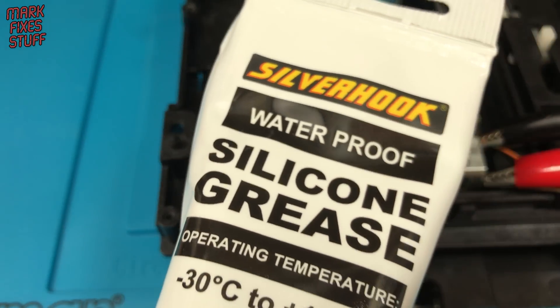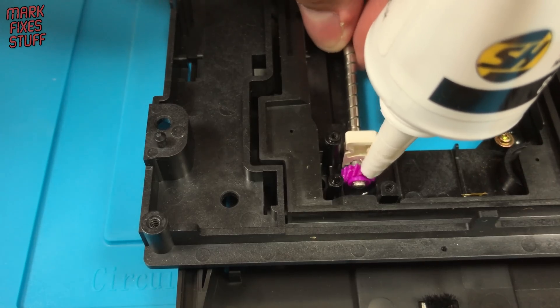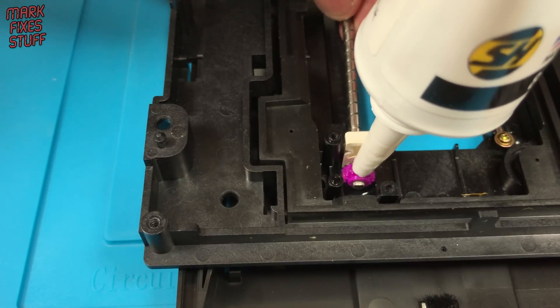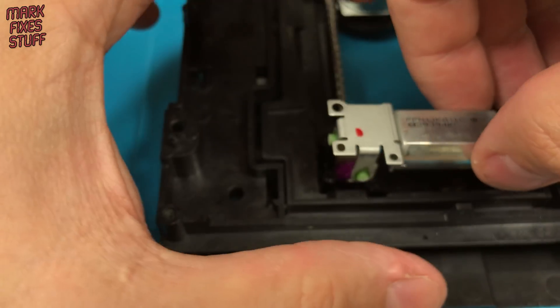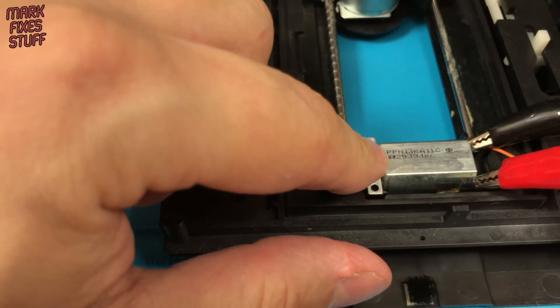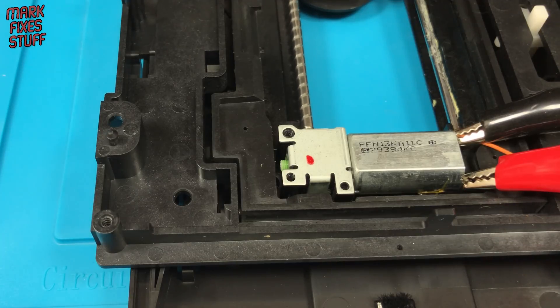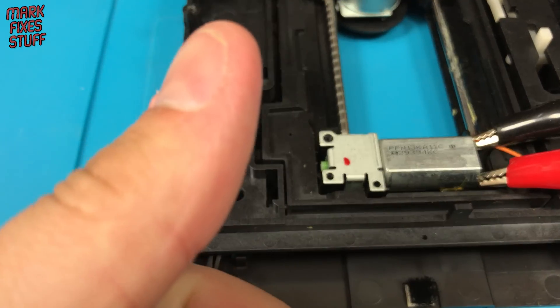With that test done, it's time for lube. This silicone grease is rated as plastic safe — not all are, so check your tubes. With the grease installed, the printed gear is only moderately louder than the original gear to my ears. This looks really promising.